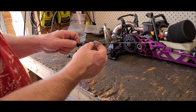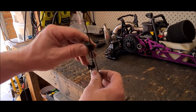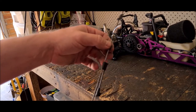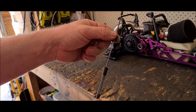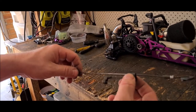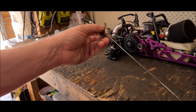What I might do is get a bit of fine sandpaper because the smoother this is the better it is for the whole thing. In the past with these things — HPI might be different because it looks like the hole's big already — but a lot of the time this gets quite sticky, so when you back off the throttle it'll stick. I can feel something there where that collet was screwed in, so I'll just sandpaper it smooth. If you've got a Rovan or a King Motor and it feels sticky, just drill it out to the next size up, which gives it room so dust can get out instead of jamming it full of dust.